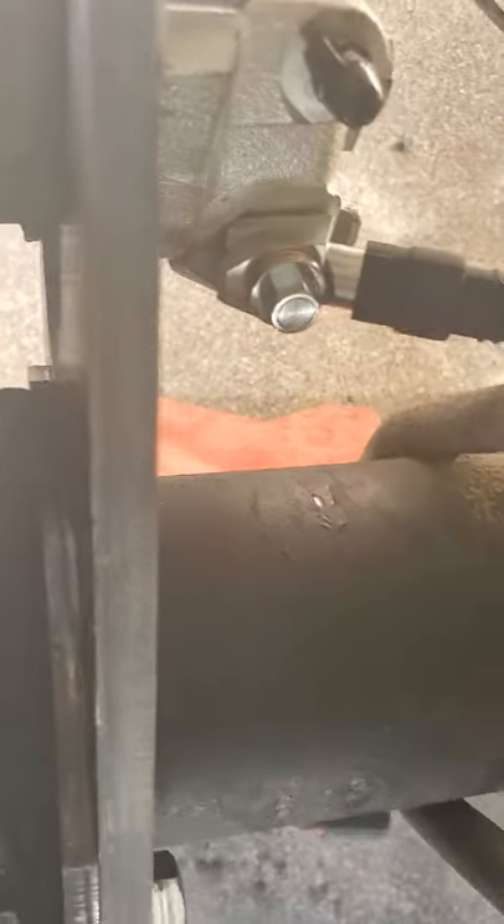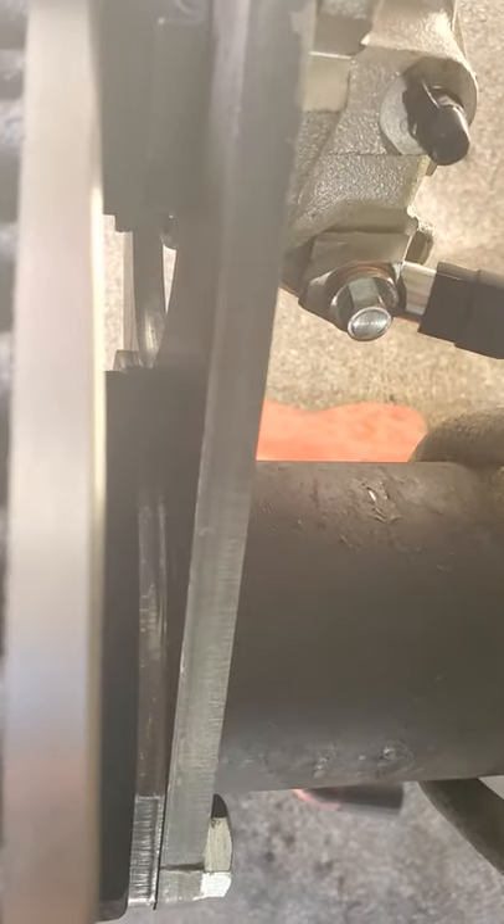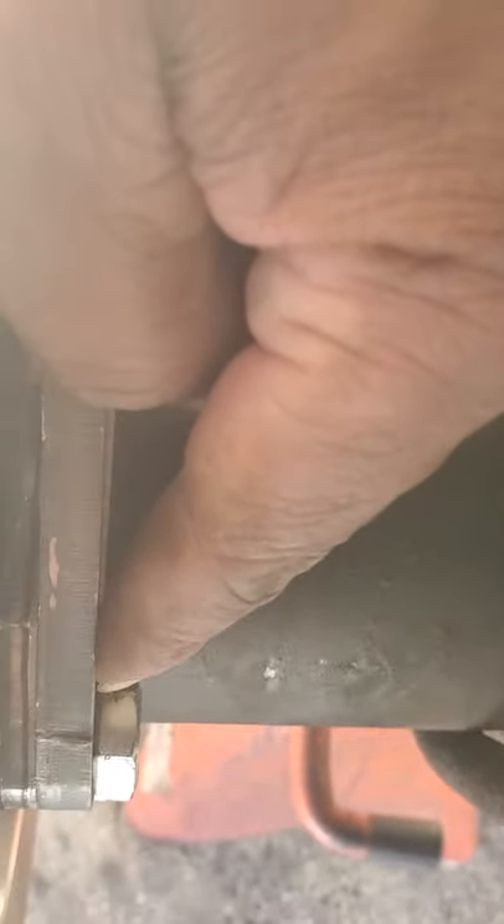After you get that, with the kit from CP Attic you're going to have this mounting plate here — I'll post some pictures as well — as well as that additional spacer. You can see it right there. Also, you have to go get some new hardware: one-and-a-half-inch bolts to bolt it in place, because the other ones weren't long enough. That is something you're going to have to take into consideration.